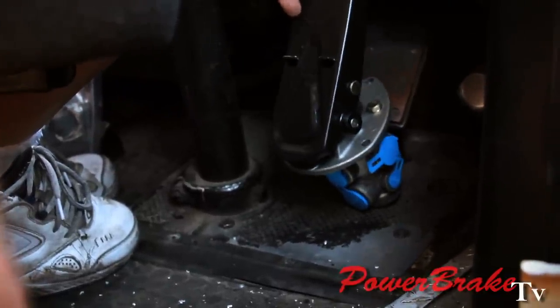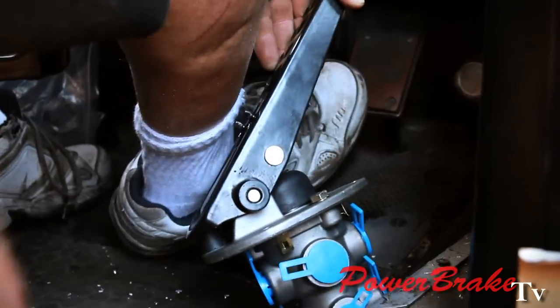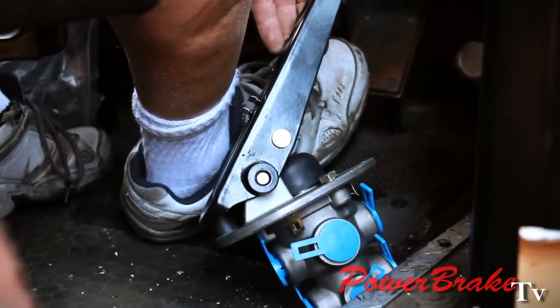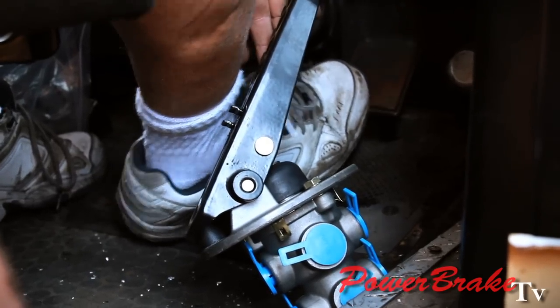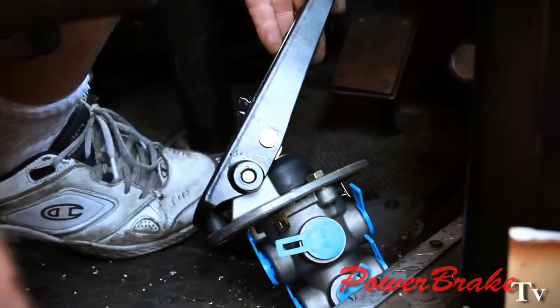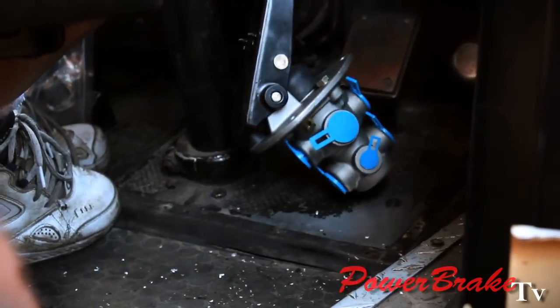What is that behind the pedal? The original brake pedal is strictly a hydraulic valve, but now that the original transmission has been removed there is no hydraulic pressure for it to use. So that's why we're going to the air system.